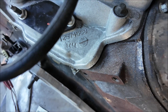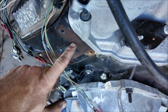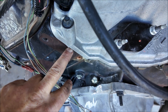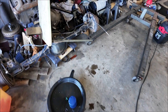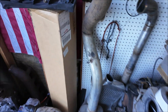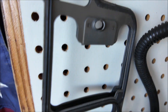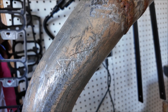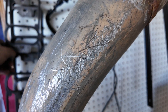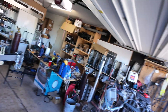Five nine — the intake has divots for the intake bolts and uses black bolts. I thought the heads had differences, like where they drill a hole, because I've seen the gaskets. Maybe it's a combination of a bunch of different things. I don't know — let me check up here. Here we go, here's a set. See these? Those have a little divot to fit inside the hole in the head.